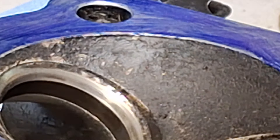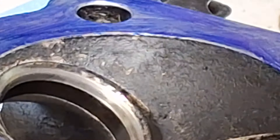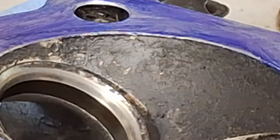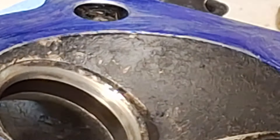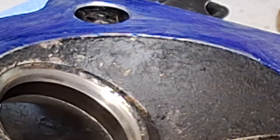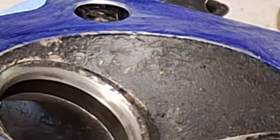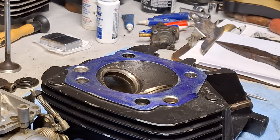When I'm doing this, I'll use old valves — actually I'm going to use these valves because they're still good, they're in great condition. But I got valves out of the other head that are trashed; the faces are gone on them. They could probably be ground, but they're pretty much useless to me because I don't have a valve refacer. I'll do the video on that when I start these heads, probably next week sometime.